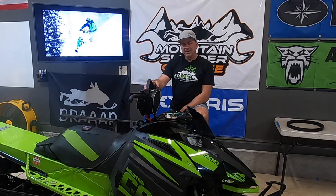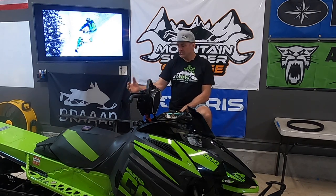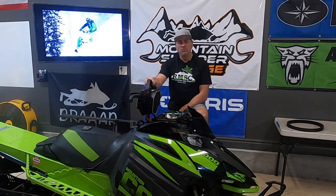A lot of people talk about the mountain sleds' problems with cooling, especially on the trails. Everyone knows the mountain sled wasn't made for trails. On the longer trails, you're going to get less snow from your track flipping up on your cooling system underneath your tunnel, and so the bigger problem you're going to have is with cooling when you're on the trails. Some things you can do to help with that: make sure your cooling system's topped off and make sure that you don't have any leaks.